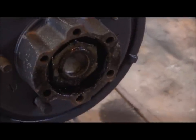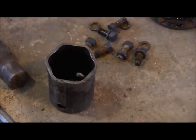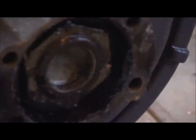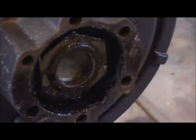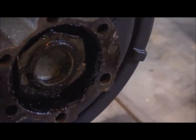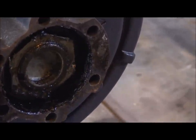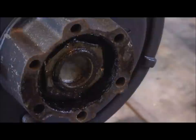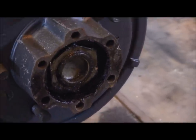Another Jeep issue also found on the trailer is the wheel bearing lock nuts. The lock nuts on the wheel bearing take a special wrench to loosen them — not a problem, we have one here. However, it is almost a given that someone was in there before you and didn't have the proper tool, so to get the nut on or off they used a chisel. You can sort of see the chiseled edges around the grease area. We can grind those notches out and put it back together with the proper tool.